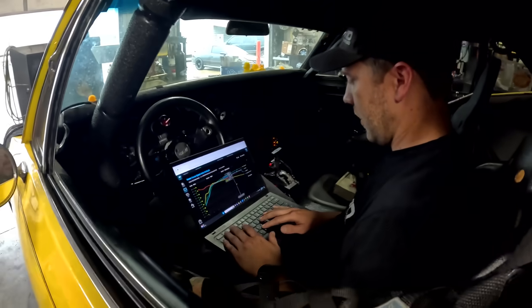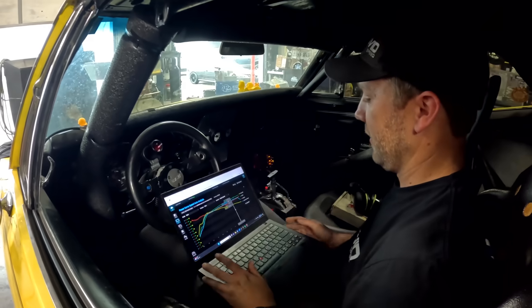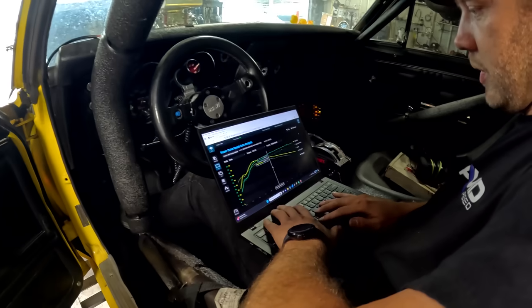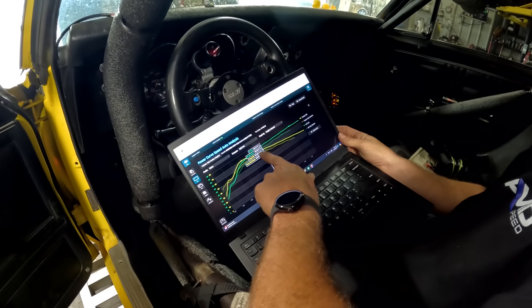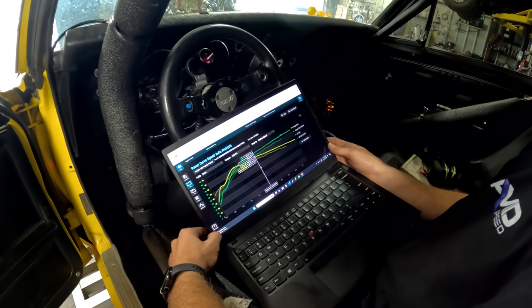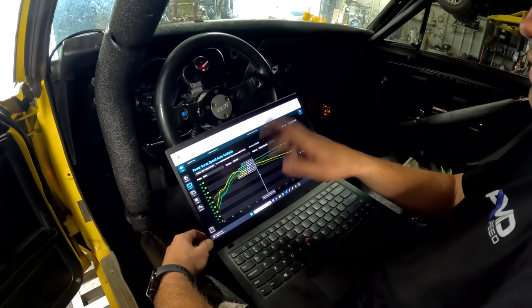So are we better now? Everything's working. Tune not much better, but the dyno's working better. Wideband's still showing low 10s, even with the jet change, so we're a mile off still. But that jet change alone was already 43 horsepower, right at this spot. Yeah, that's what, 37, 38 horsepower gain just going leaner on the jets, and we're talking way down at 4,400.